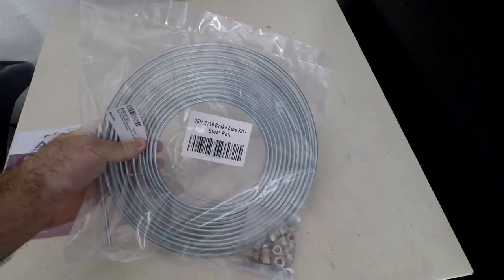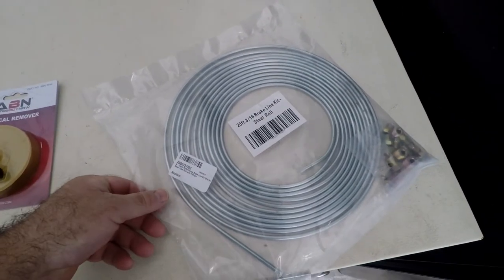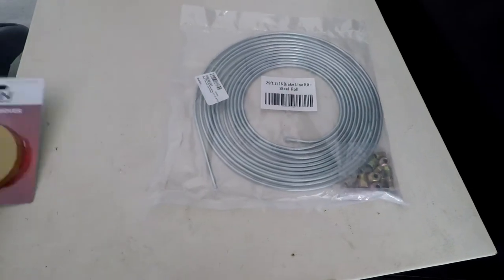Broke one of the brake lines because I was trying to get the line lock bolted back to the shock tower. Old lines, one of them broke. Go ahead and just redo all of that right there, and then I'll pull the master cylinder out, bench bleed it, and then put it all back together. Just plain steel 3/16. It's a kit I got off of Amazon. I'll link it in the description.